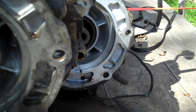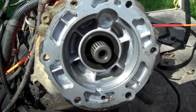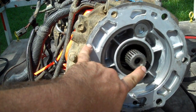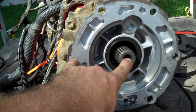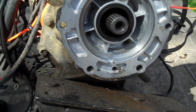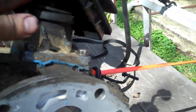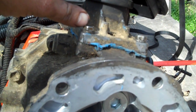That way I don't have to drill. Your other option is if you're building a Wrangler or got one with no engine, no transmission, and the only thing you could find was a Cherokee, I'll still show you how to make a template to drill these holes. But the first thing we're going to do is get this tail shaft off the Cherokee tranny. First thing you've got to do: you have two bolts way up inside here and four bolts on the bottom. Four bolts hold the shifter, so I'll get them snatched out first.